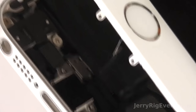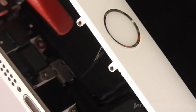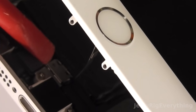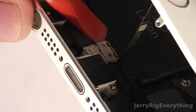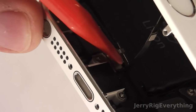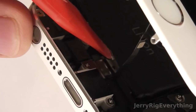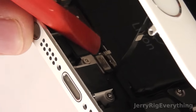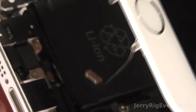There is a little clasp that you have to lift up — it's just like a little latch. I'm going to get my pry tool in there and just clip it up. You can see it bend back just like a little door, and the whole thing comes off once I get the ribbon cable unclipped. It's just kind of like a Lego — lift up and away from the bottom and it unsnaps.